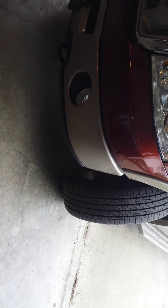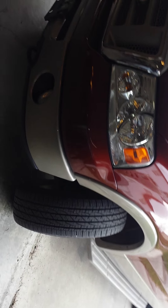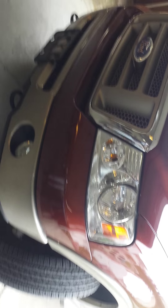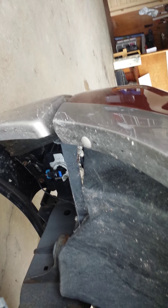I was sold after installing these headlights. For those of you who haven't installed headlights on your F-150 before, you do have to take off the headlight assembly to get access to the connectors in the back. For the fog lights, they're easy to access — you just turn your wheel all the way out so you have easy access to the connector right there.